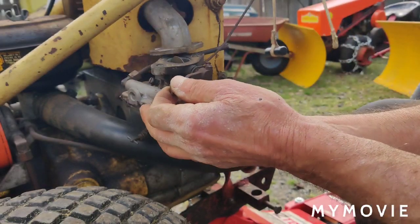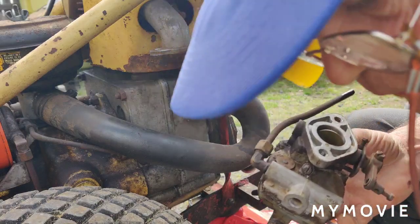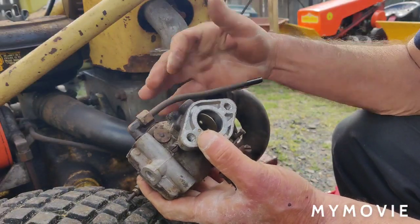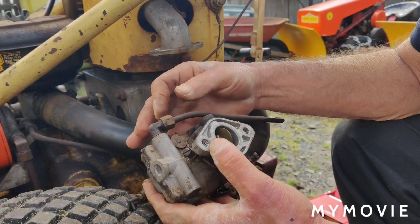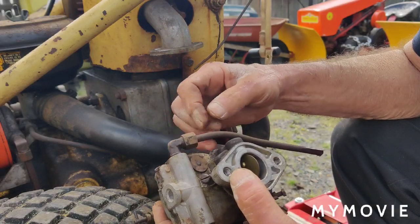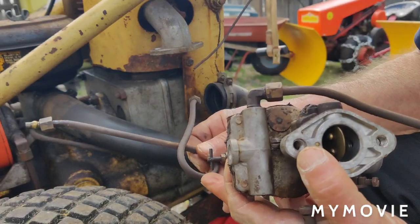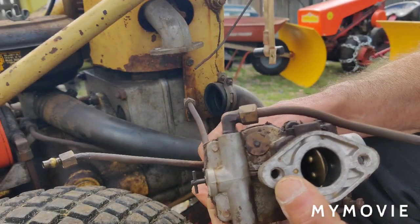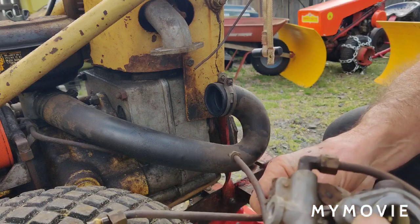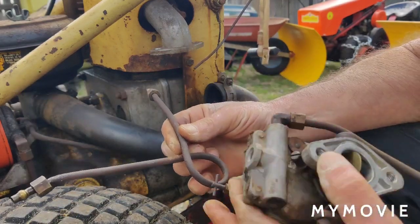I don't know what the steel fuel line came off of — it seems to be a little bent. So the gasket — I'll just take the gasket off and hope the wind doesn't blow it away. We're just going to undo this line here that somebody cut. I'll try to screw the other one on there, get it in place, and then we'll put the sediment bowl on and see if I can bend it to where I want it. I sprayed some brake clean through here and WD-40 also, and I blew out the line. It looks like the line does go on this way. I already bent this part over a little bit because it's supposed to have this loop in it.